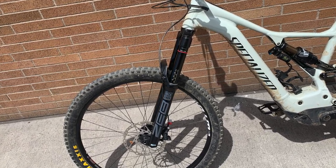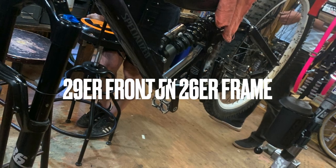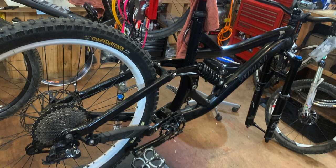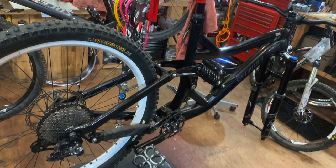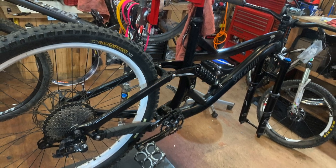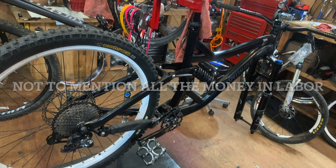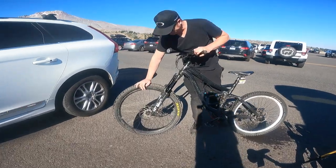I was upgrading the front end on this bike and had all the spare parts, so I said let's put a 2021 e-bike 29er front end on a 10-year-old downhill bike and see how it works. It was even hard for the shop to do. I ended up having to bring it to a custom wheel builder, and he struggled — he had to build a custom shim for the funky 135mm rear wheel spacing just to make the derailleur work. It was a total struggle, unbelievable.